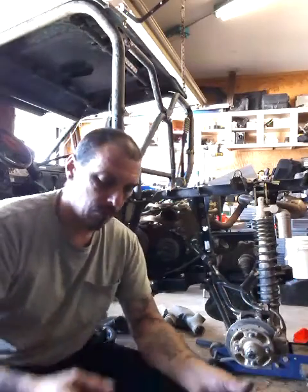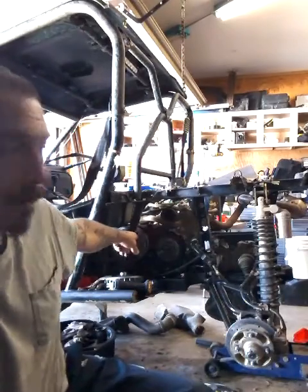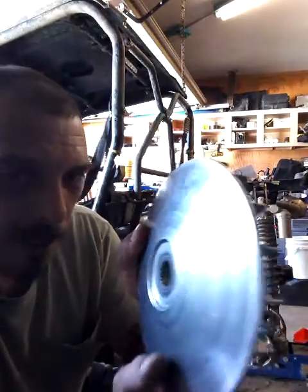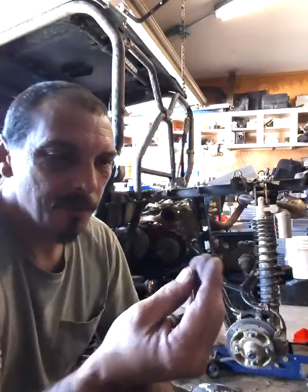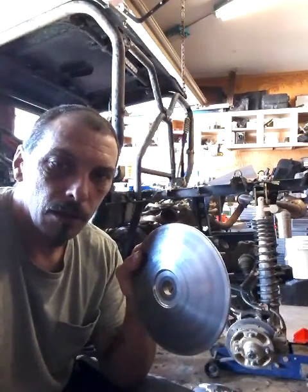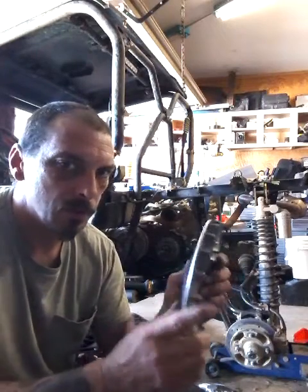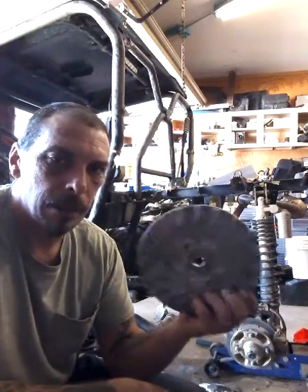And what I found was this. If you look here, there's gears, and on your shaft coming out, it has gears. So this thing's supposed to lock into place. But if you can see inside there, look how smooth that is. I kept getting this metal color. You can see it on my hands. I mean, it was horrible. I kept having to clean my hands off, and finally I put a pair of gloves on. But there's no gears on the inside. They're gone. This was wobbling. Weird. So I think that this was my main problem to begin with.